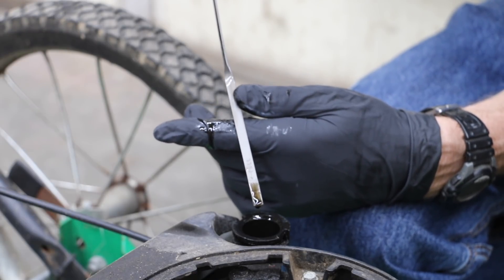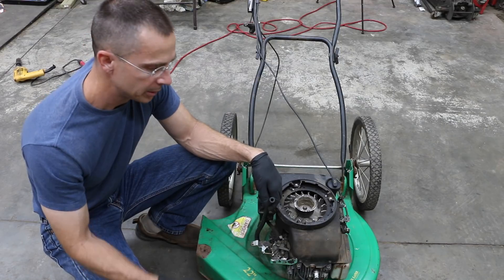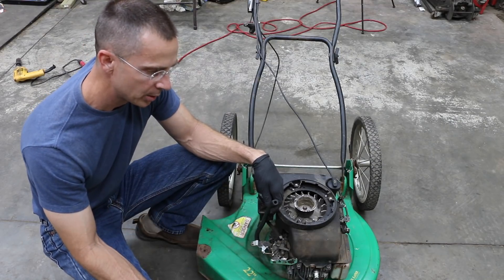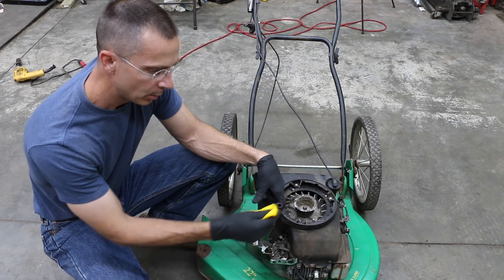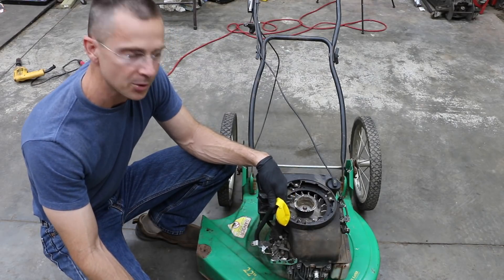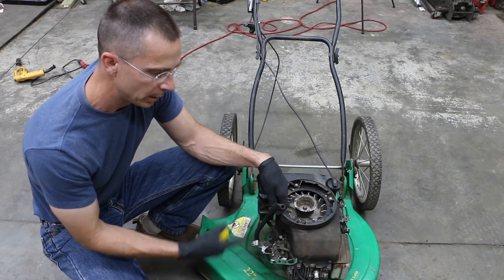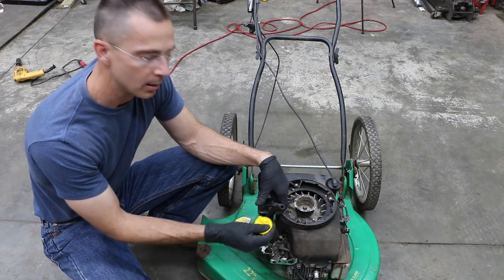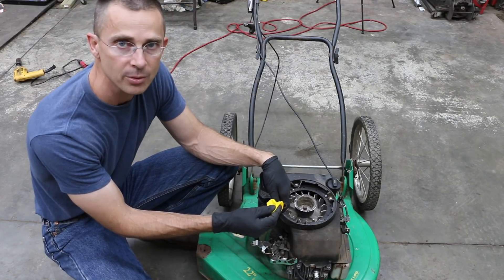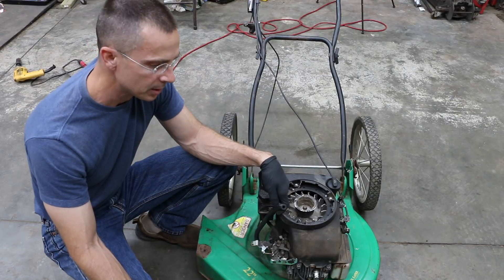As you can see, it's just a shade below the full mark. There are many ways to measure blow-by. What we're going to do is take the crankcase ventilation hose and attach a balloon to it to get a baseline measure — see how long it takes for the engine to inflate this balloon. Then after we run sand through the engine, we're going to see how long it takes for the balloon to inflate and measure the difference. And finally, we'll add the Rislone to the engine.